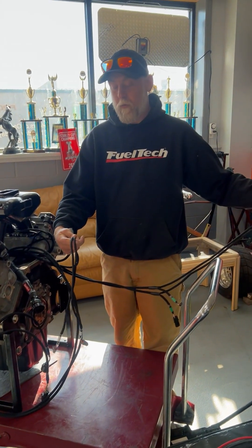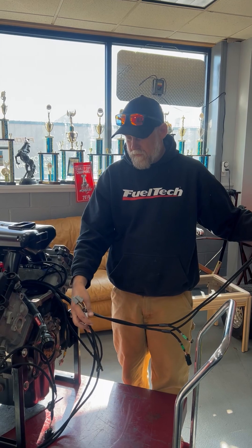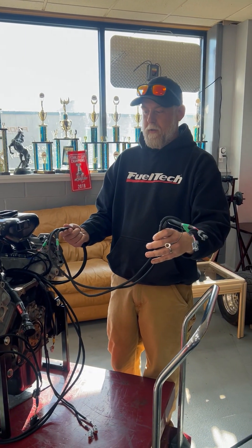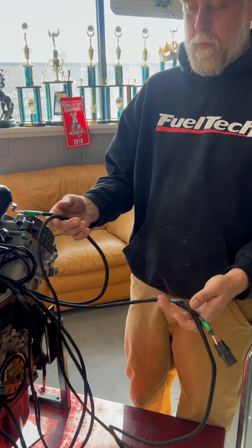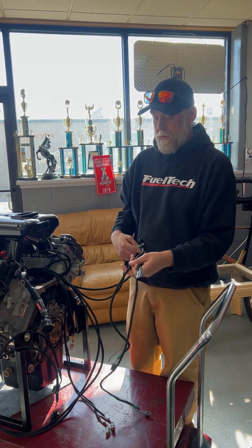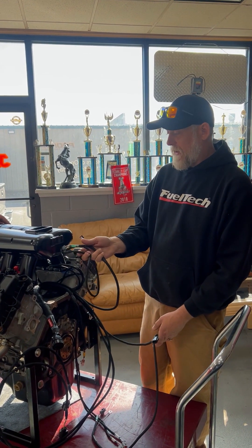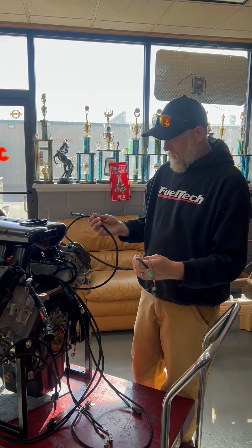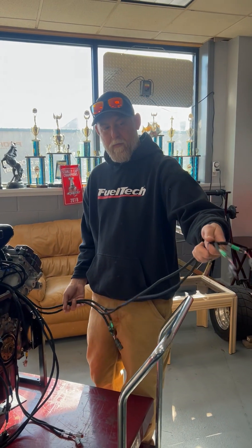The other things we've got back here: a CAN hookup for EGT4 — normally these would mount to the firewall or something like that to get your EGT links to your headers. Last are your cam and crank — these are two pieces you're going to have to modify for a coyote, because a coyote doesn't have GM-style connectors or an MSD, so you're going to have to cut these off, put the coyote end on, and shorten them. That would be a part of the wiring you're responsible for on your end.